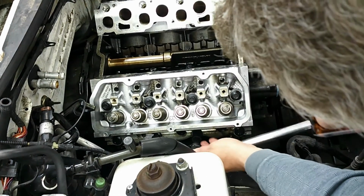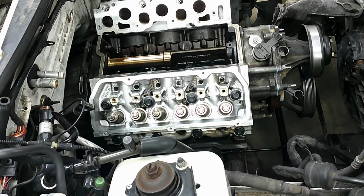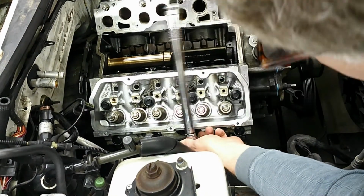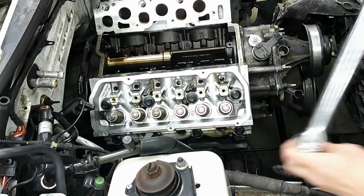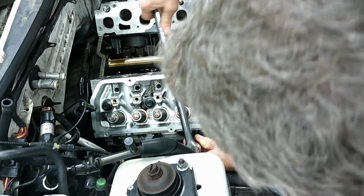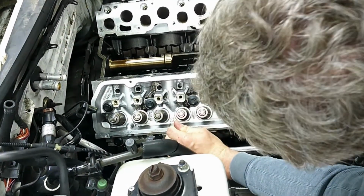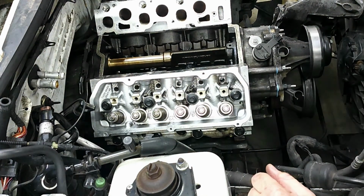Okay, to the next one, which is a short bolt, so we'll loosen this guy. And since this is a short one, we're going to just torque it to 18 pound-feet. So adjust my torque. It'd be nice to have two different torque wrenches here so I don't have to go back and forth. But here's 18. Right there, not a whole lot. Okay. And then 180. So again, I'll break this up into two 90s. There's 90. And another 90, so there's 180. And then I'll just continue the process, but going back and forth until I'm done.